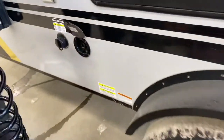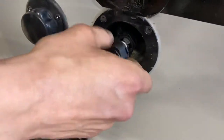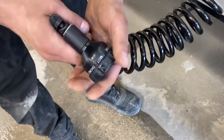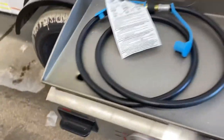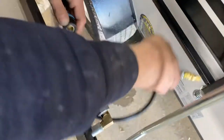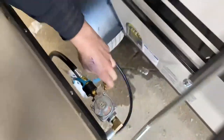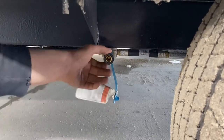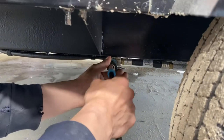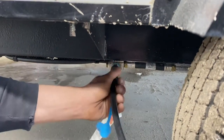For the hose on the back, line up the two little ears at your three and nine o'clock positions, press it in, give it a little eighth turn, and that locks into place with a click. This ties into your cold water system — you won't get hot water out of here, just cold. You get all your different spray settings, basically a garden hose attachment. When done, push it in and pull it out, and make sure you stretch it and let all the water out before storing. At the stove, pull the black collar back to disconnect the propane line — that collar attaches to the back of the griddle the same way. Underneath the unit near the back of the axle is another quick connect with an added valve: you cannot undo the quick connect while the valve is open, so you have to shut off propane flow before attaching or detaching a hose.